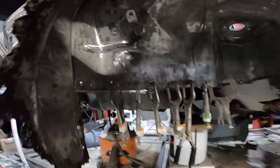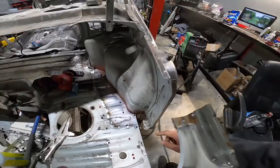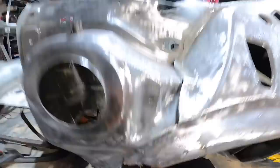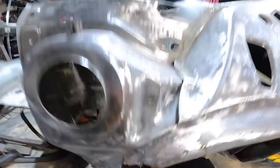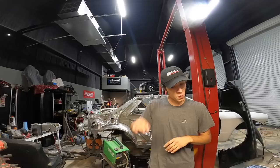Just been tacking this thing in, moving around to keep the heat out of it. Got all my spot welds lined up exactly where they were, which is really sweet. Up in here it just fits up and looks brand new — love that, no more rust peeking through. The copper spray almost has that look of rust, but thankfully it's not. I'm going to toss a few spot welds down here and get this thing in place. I ran out of my sanding discs — these roloc discs — so I'll probably do the welding and then have to clean it up later, but it's coming along well.